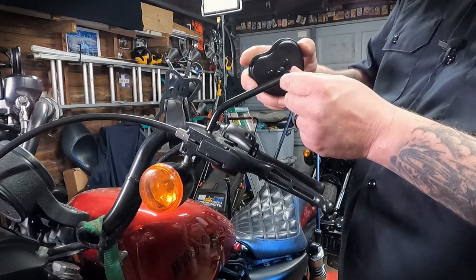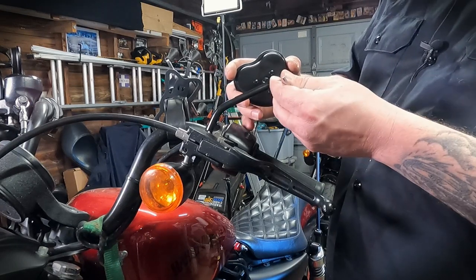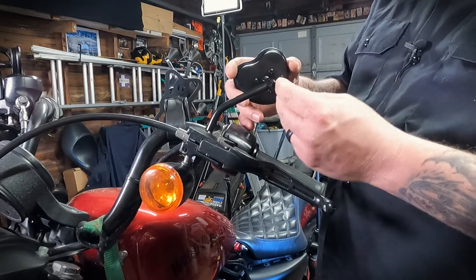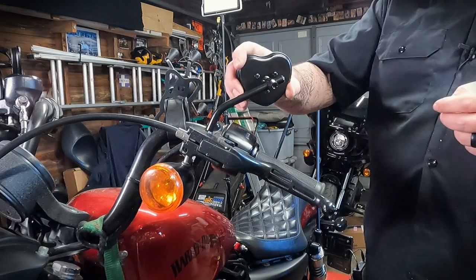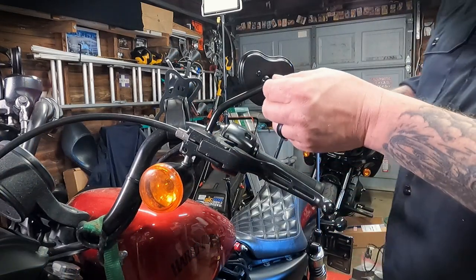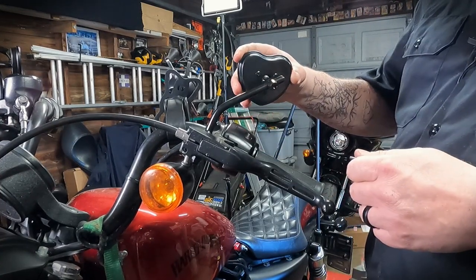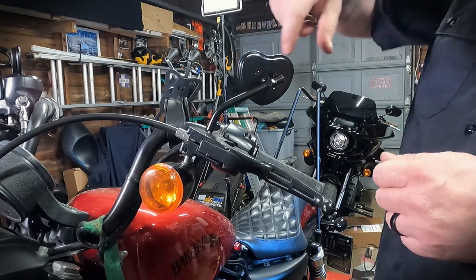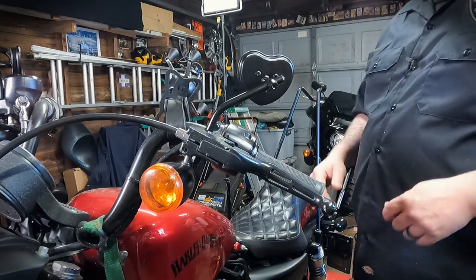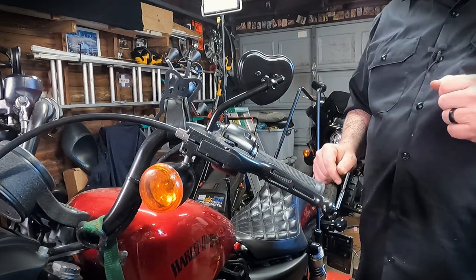So again, we're going to slide through that hole there, slide down onto wherever you want on the shaft — completely up to you. Take the Allen wrench, snug it up on there, put it in place, step back, give everything a visual, make sure it all looks good and lined up. Then take the Allen wrench and tighten up this Allen screw. And again, if this mirror is loose, you can tighten up these three little Phillips screws on here and it'll tighten up the ball and socket. But this one's pretty good to go right out of the box. There you have it — everything's mounted on, they look pretty good, and we're ready to go ride. That's all I have for you today. Thanks for watching.